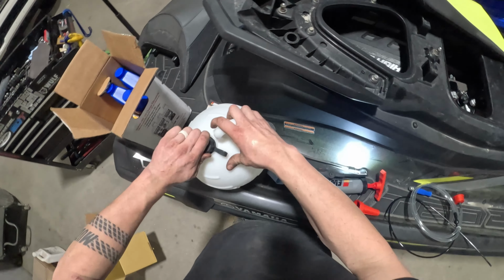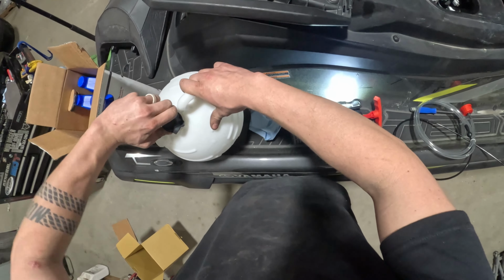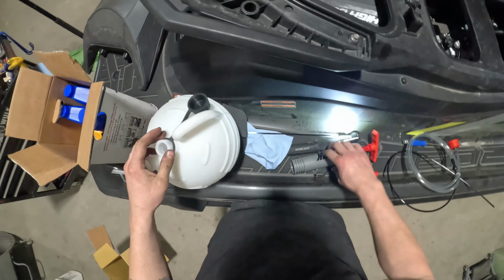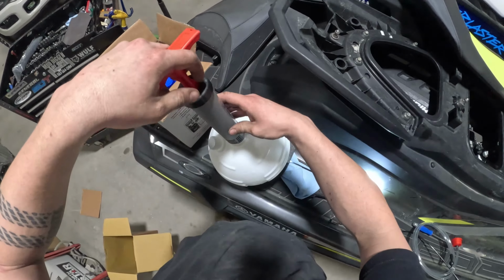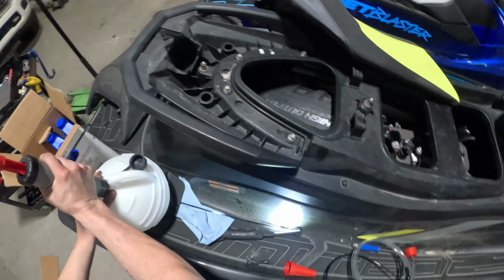So you can go ahead and knock out the oil filter, spark plugs, and anything else you need to while it's draining. It will take about five-ish or so minutes to do a full drain, and you're gonna be looking for about 3 to 3.5 quarts of oil if it was fairly full once you started.